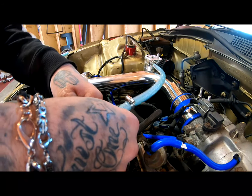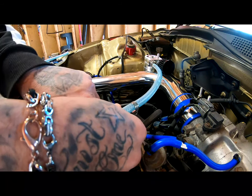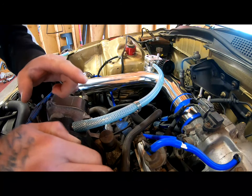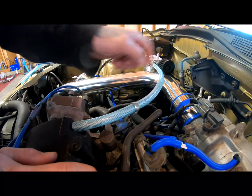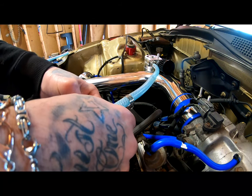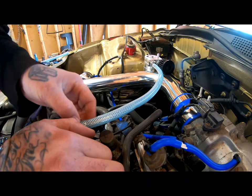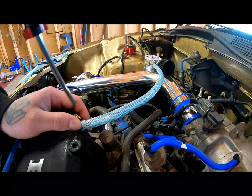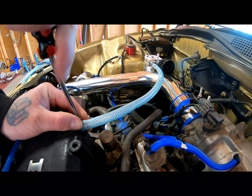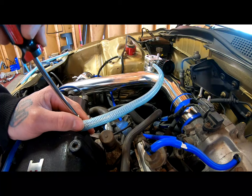And I know once the car starts making pressure from that turbo, there's going to be pressure on this head. I already know. And I really don't want to recirculate it, because as you guys know, it goes from here to here, usually on the regular intake. And I don't want to recirculate it because they say that you get a lot of carbon buildup on your valves because of this, but also because of the turbo, there's probably going to be a little bit more oil than normal, and I really don't want to burn all that stuff. I'd rather just catch it and dump it out.